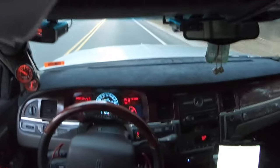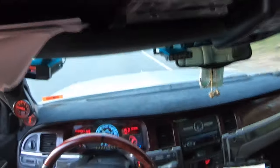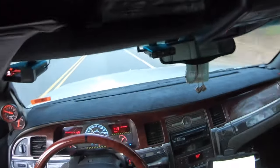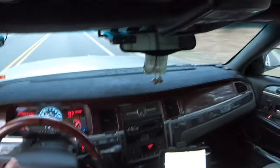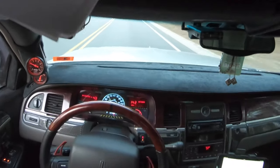And this is pretty cool with the sprint booster that I have here, which actually controls the fly-by-wire throttle bodies. It actually makes it react quicker. But I think the trifecta for this entire setup would be for me to get a J-mod on the transmission. That way you have real noticeable shifts. The other thing too, a lot of people, and I mentioned it earlier in this video, they complain about the shift reaction time. If you have a tuner, like an SCT tuner, a handheld tuner, you should be able to firm that up or make it shift a little quicker. So that's definitely something I'm going to be looking into, since I do have an SCT custom tune on this car. So we'll play around with this a little bit more.